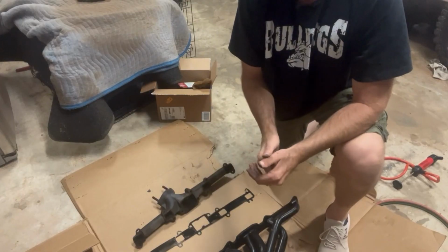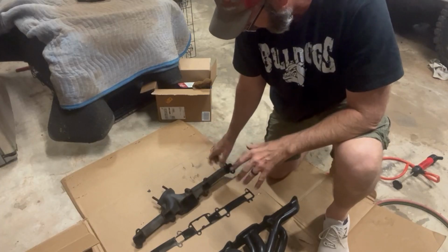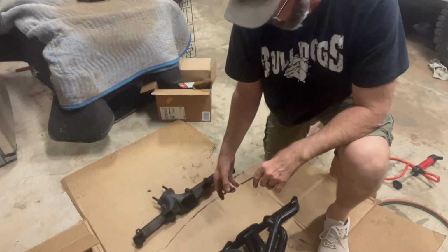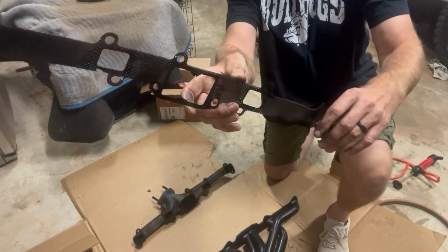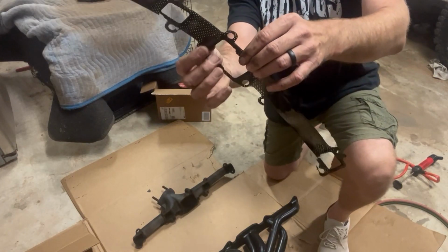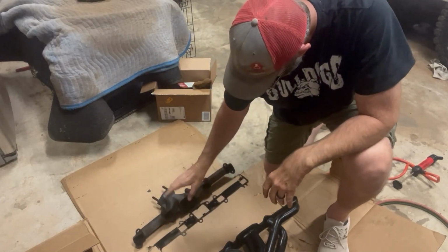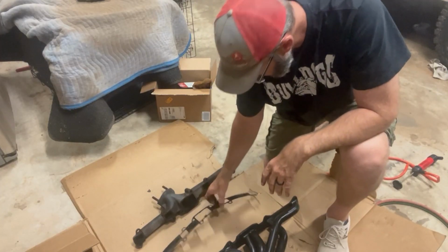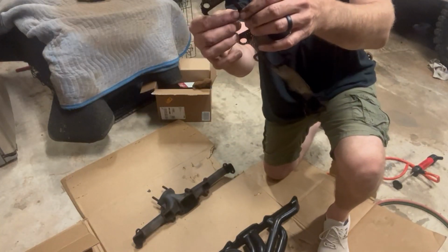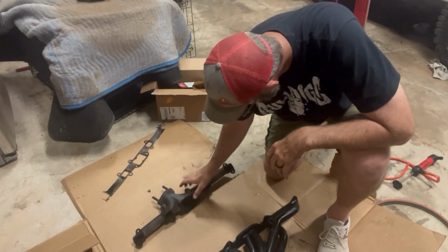All right. Exhaust deleted. So now with the stock manifold off, I can show you a little bit here. Part of it being exhaust leaks. Gee, I wonder why. This is brittle, falling apart in many areas, and all but 3 bolts were totally loose on it. So that could also cause a gap for air just to go through and blow that gasket apart after a while. So that explains that.